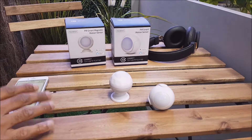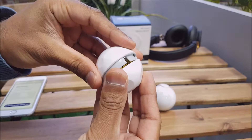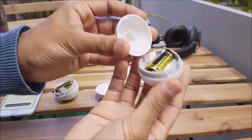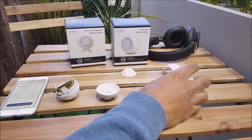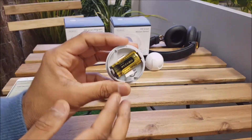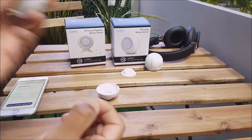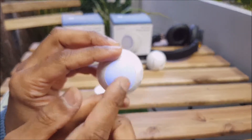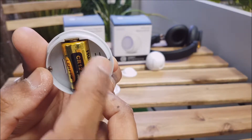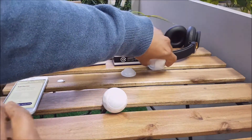Let's look at this particular one here — both will be identical. You'll just need to unscrew that and it will come away. You'll find a little tab here on the battery which is just stopping the contact, so you just want to pull that out. Now that your battery's got contact, if you don't find that you've got a quick blinking blue light, you just want to press and hold this little reset button here for about five seconds to get that flashing blue light. Because this one's flashing, it means it is in pairing mode.